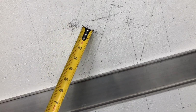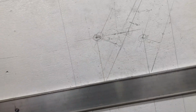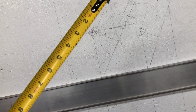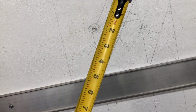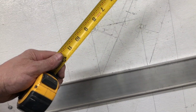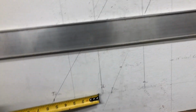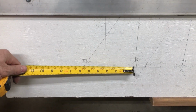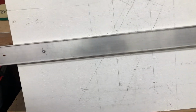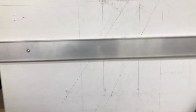I mean, it would be nice to do 2, but with a girder front end, even 3 is going to be tough. I have to make it pretty tight, and you don't want it vertical because then you won't get any suspension. You want a little bit of an angle, so I'm going to put a shock in there, so I got a little bit of angle for that shock to compress. So with that, the trail is going to be 5 3/4 inches approximately. Don't want to go any farther than that.